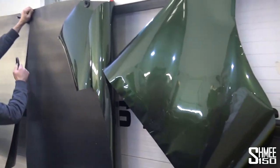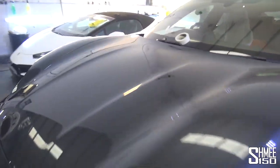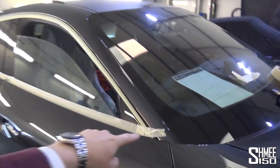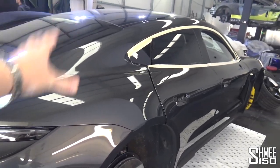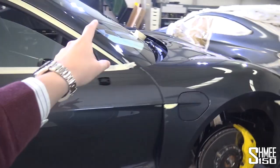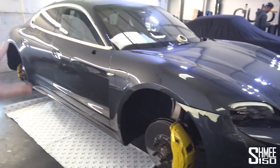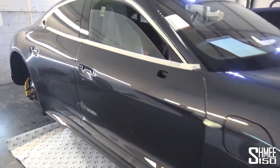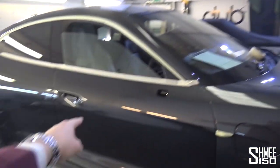One of the first steps is to work out the different pieces. We've got a lot of vinyl in different rolls already packaged away, having measured out the various sections of the car. Because when you have significantly larger parts — like the A-pillar all the way across the roofline to the rear quarter — that is one single piece, about 3 metres 40 centimetres of material. You need to be careful with this material because of the qualities of the finish — you want to have it all in the one direction, every part effectively running from front towards the back of the car. Then installation begins, which I think in this case is going to be the driver's door up first.